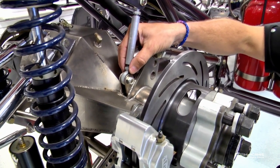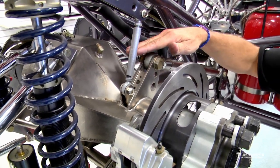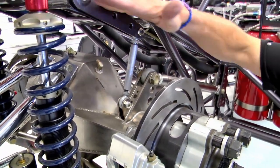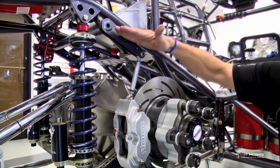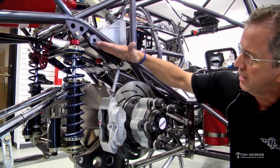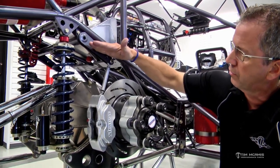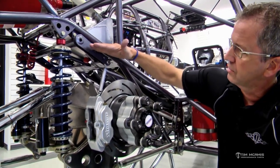This rear end is currently hanging. If it were jacked up to ride height these arms would be more flat, which is the best position. At ride height this arm should be very flat — you don't want it down at an angle — because it's designed to use the leverage of the arm and the torque in this tube to keep both arms parallel with each other. At ride height we'd like this to be nice and flat and this link to be square with the actual centerline.